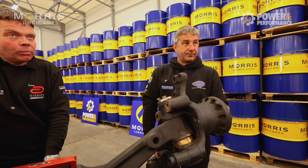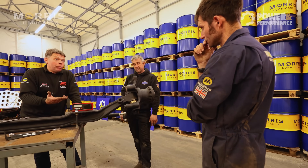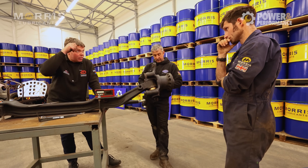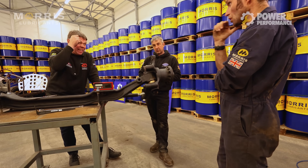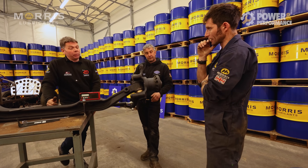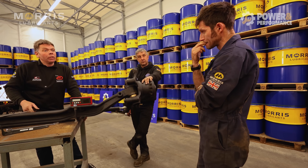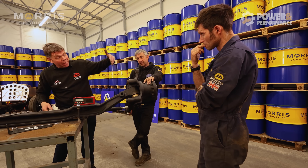We needed to make it legal. We could have carried on with the old axle — we could have just put four degrees of wedge in it and reduced it back to being legal. But then we would have had a wedge in there, so we'd get a ride-out increase. As your truck was previously, it wasn't legal — they've changed the rules over the 2025 range. Because we were running about 36 degrees in our old truck, and some of the teams were running 42 degrees of kingpin inclination, which was absolutely radical.